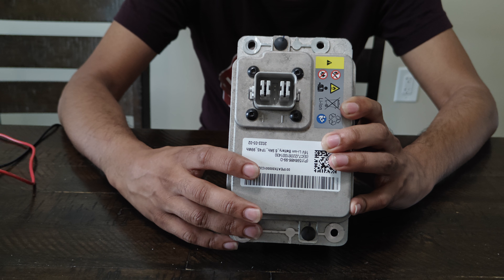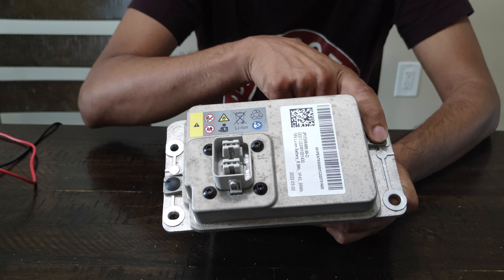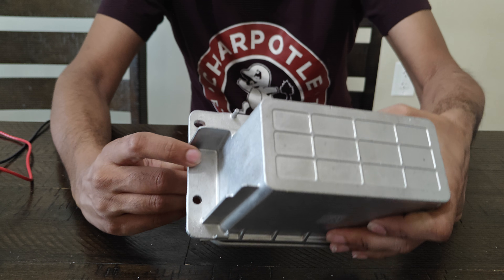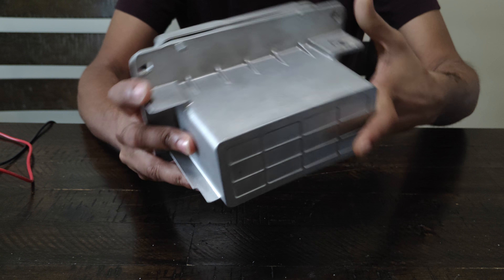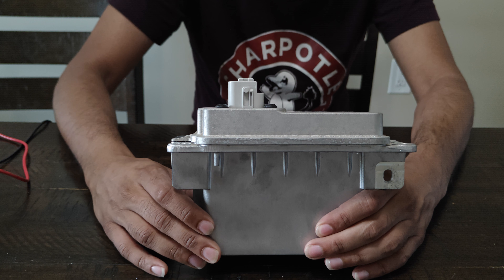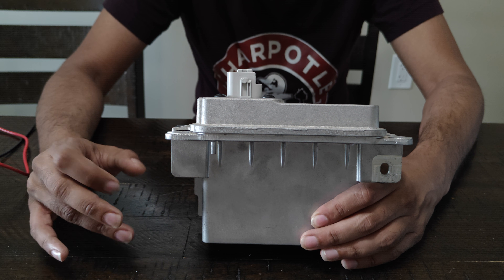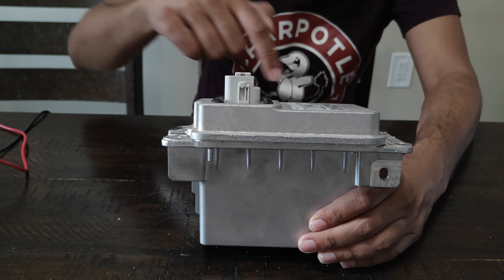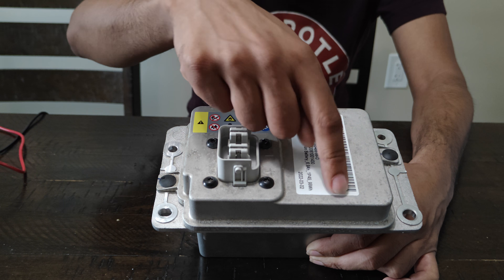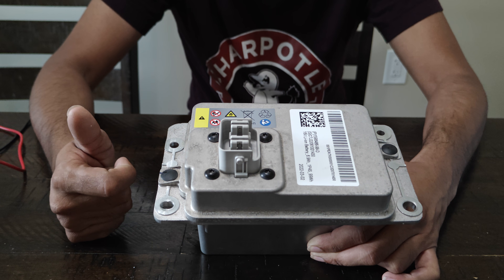The third way is basically opening it up. As you can see, there's a plastic piece here, a plastic piece here, and four screws. Take out the four screws and pop this off. You can take a flathead screwdriver and just hammer it out. This is just caulking around it, so you'll heat it up very, very lightly and slowly. Please wear gloves to keep from getting burnt, and you'll also need electrical gloves so you don't get shocked. Once you open it up, you'll have two terminals — one down here which is the positive, and one up here which is the negative.